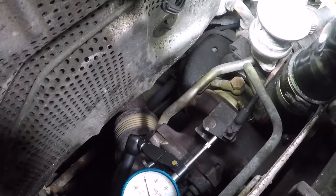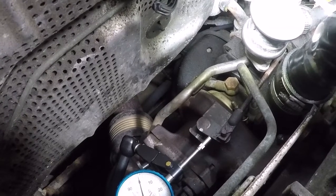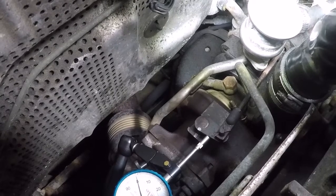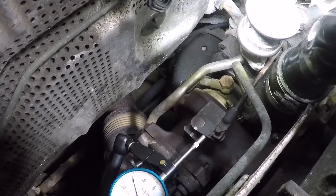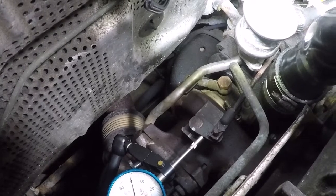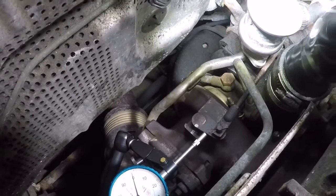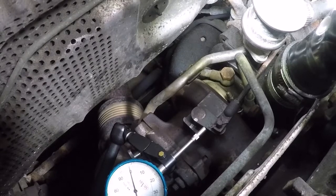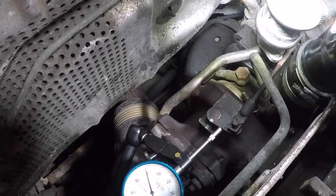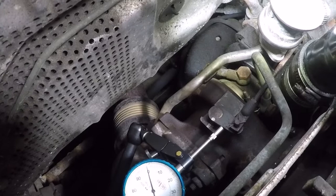How much will that make a difference? I don't know. I think I should get at least four pounds of boost because electronically it shouldn't inhibit it. If it overboosts I'm going to get a code. If I go stupid and say I'm going to sit at ten pounds — dude, this is a low pressure turbo car. Don't beat on it. It's lasted for decades, it'll last a little longer. But this little bit that I'm doing here is more for clinical analysis and just for fun. I don't drive this car hard at all. It respects me, I respect it, and we've lived just fine together. I wanted to try this just to help explore and make sure that we had everything set right.